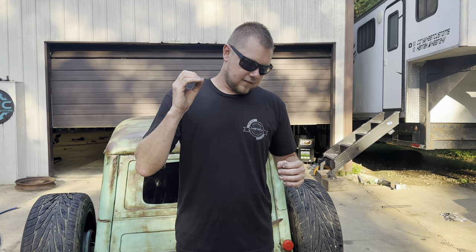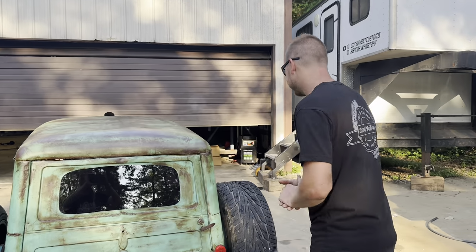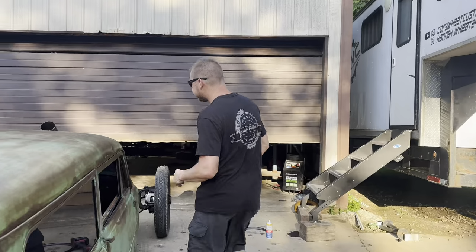What it was real quick was, you got an oil feed line and an oil drain line. The oil drain line wasn't draining quick enough, so it was filling the turbo up and going out the exhaust and the intake side. And where I had the oil drain pipe going into, the other turbo was pushing oil up that line. So there was no place for the oil to go, and I think I got that fixed now. So this is what I got.